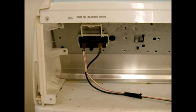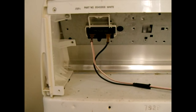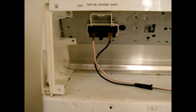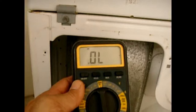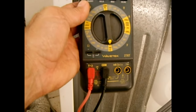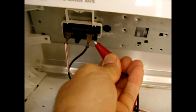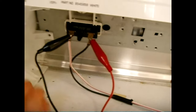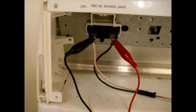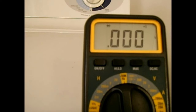We're now in the upper compartment looking at the start switch. It's very possible your dryer won't start because of a faulty start switch. To check it, use a continuity tester — a light, a buzzer, or a digital multimeter on a continuity or low-ohms setting. Connect one probe to one side of the switch and the other probe to the opposite side, then reach around and push the button. Hopefully you get a continuity alarm.